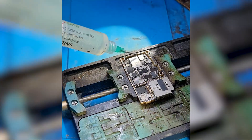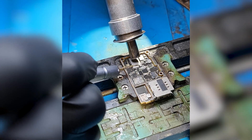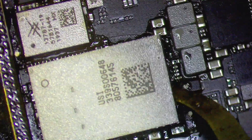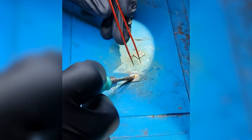The EEPROM is optionally done by soldering. The problem however with this chip is that it's made from glass, which makes it very fragile. The board swap will fail entirely if you fail to correctly transfer this chip. This is why many repairers copy the EEPROM baseband data with the JC programmer — this way they don't have to transfer the chip, which saves a lot of headaches.